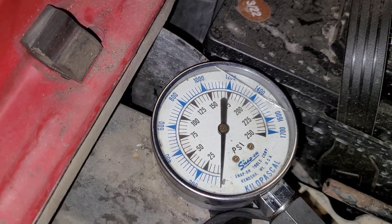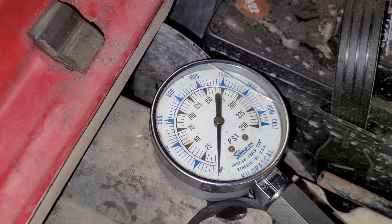In that video from my bore scope, you can actually see the piston going up and down and both valves opening and closing. I also included a picture of the top of the piston - the best I could do. The piston looks pretty good, so I doubt it's melted. But are the rings stuck? Are the valves not seating? Are valves hanging open because of a broken spring? I'm going to do a compression test again - I just loaded it with transmission fluid. Absolutely nothing. So now I can either take the valve cover off or do a leak down test. I think I'm going to do a leak down test.